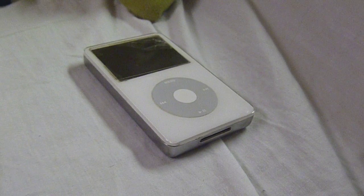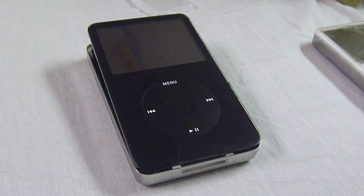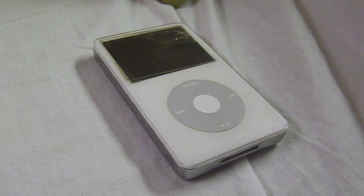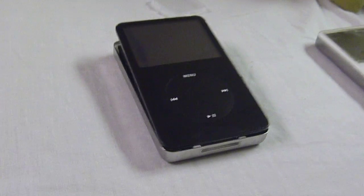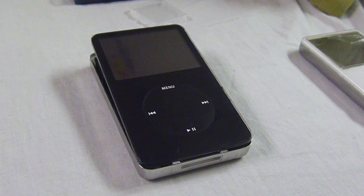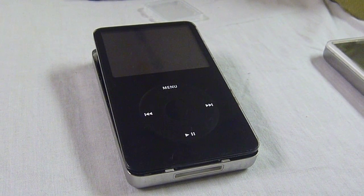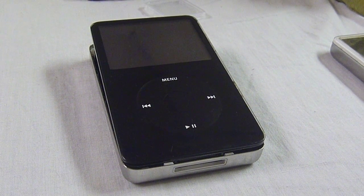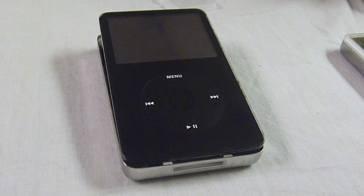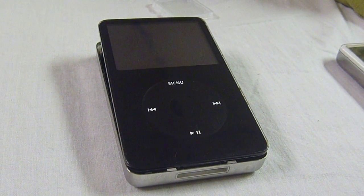In my case, as I mentioned, I'm going to be cloning this iPod over to the new one I have — it's actually cracked open right now since I'm doing maintenance on it. The next step is to eject your old iPod — make sure it's safe. What I did was open iTunes and re-initialize the new iPod so that I had a blank, clean surface to work on — a new canvas. Next, close out iTunes, and then go into the hard drive of the new iPod, highlight everything, and delete everything.